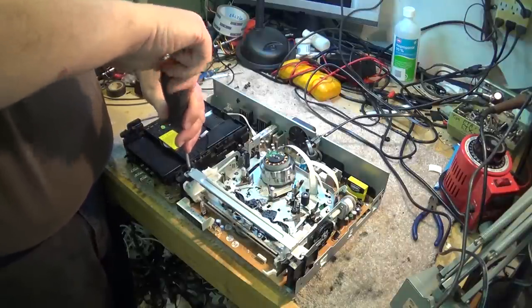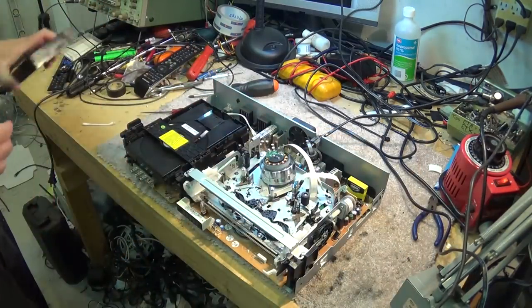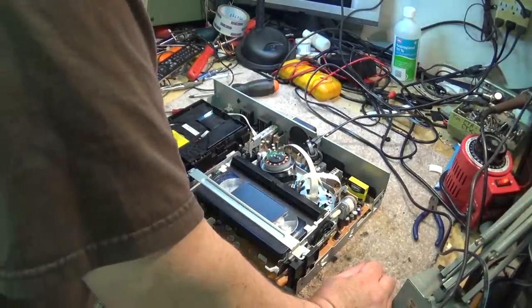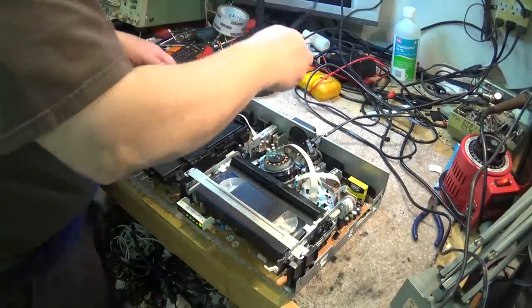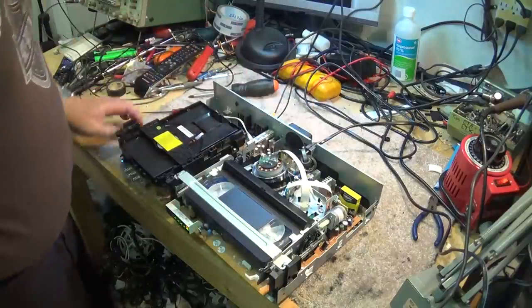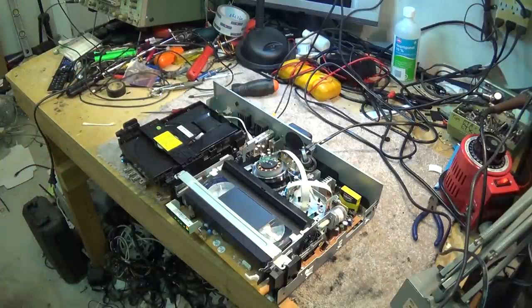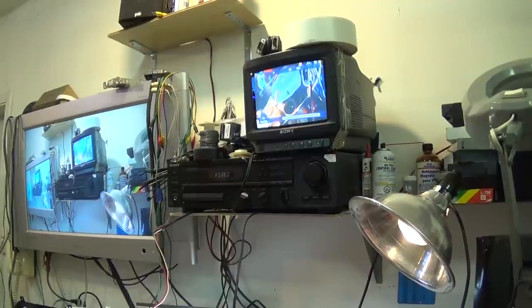We'll plug the audio control erase head back in and power it up. There's a noise — it's the fan, that's what's making that noise. There's a fan on this thing; we'll fix that — just got to oil that bearing. Using the remote control since I've got my front panel off, I'll hit play. There we go — it's playing, folks. It's playing. I fixed it! Well, almost — we still have to deal with that noisy fan.